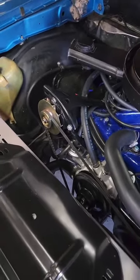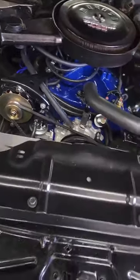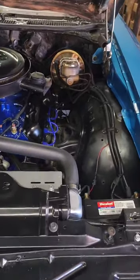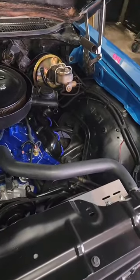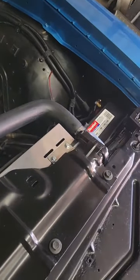Plus we have some power left over for a stereo for when he's ready for it — we'll do something nice for him there. For the brakes, this came in with manual brakes, we reached out to Lead Brakes, did their booster and master combo, added a little vacuum reservoir that's tucked in on the fender there.